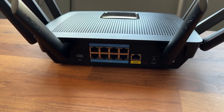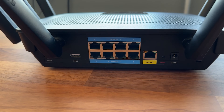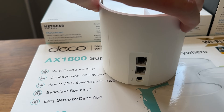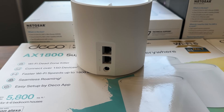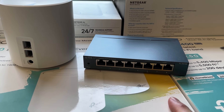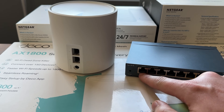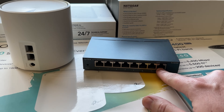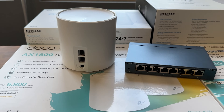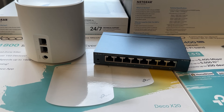Another big difference I want to show you is the back of this single device right here. A single unit device is going to have all of these ports on the back — it's going to have a switch built into it, meaning you can plug a lot of different stuff into that. But if we take a look at something like the mesh system and flip it around to the back, we're only going to have two ports on the back — not a lot to work with. That is where an unmanaged switch is going to come in handy. We can plug a cable in here, plug the other end into port number one on this unmanaged switch, and that's going to allow us to use the rest of the ports. This is an eight-port switch right here — you can get 16, you can get 24.